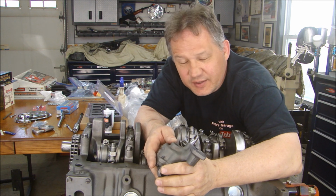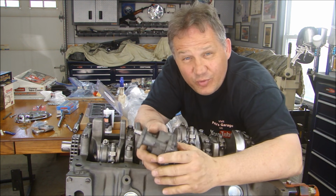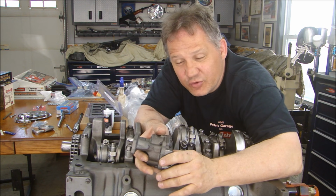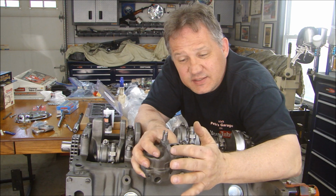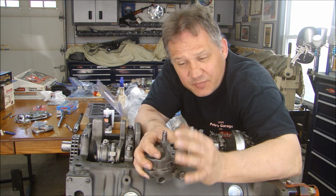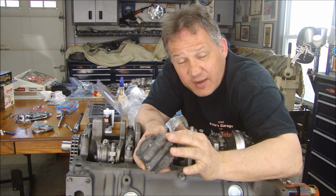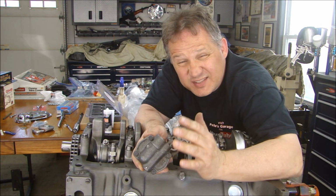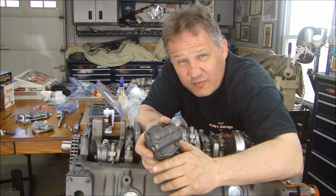Now, I know what you're thinking. Really, a video dedicated to installing an oil pump? Just put it in and put the bolt in, you're all done. That's not exactly true. There's a couple things you should watch out for when you're putting in an oil pump, especially one that has two dowel pins to locate it with a drive shaft. And then we have to put in the pickup tube that goes into the oil pan. We have to set that depth because that is really critical. So we're going to install the pump and set the depth for our pickup.